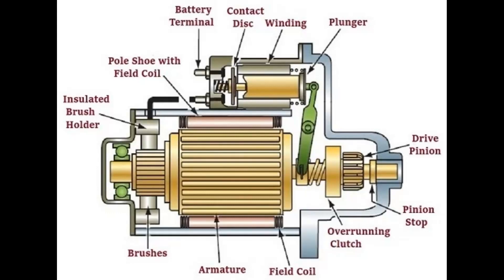What I suspect the problem is with my starter motor is that contact disc, or the contacts it's contacting against, is either dirty, or maybe burnt, or maybe they've fallen apart inside. I don't know what's happened until I look in there. But I suspect, because the starter motor still works, that the solenoid contacts are the problem. Whether you can get that apart and fix it, I don't know — I might be able to once I take it off — but I suspect they're probably burnt out.